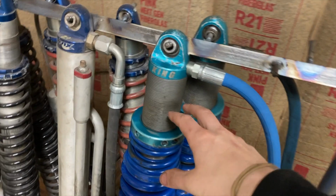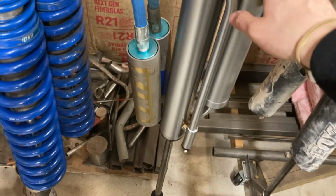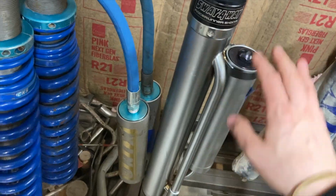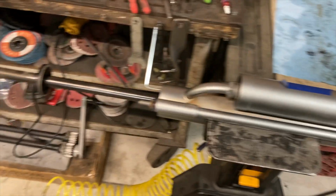and that's just like the front. These shocks are off the same truck. These are the fronts. It's an A-arm truck. It's a leaf spring rear, so just a bypass in the rear. This one was not like that. This one was good. It was still holding the charge. These ones both had leaked past and had nitrogen in. So this is another one.